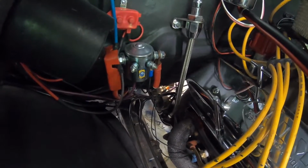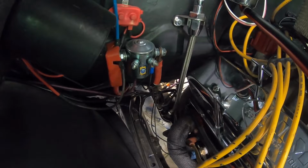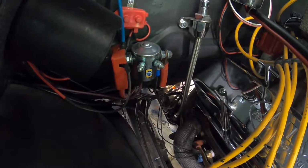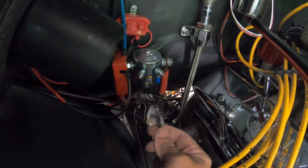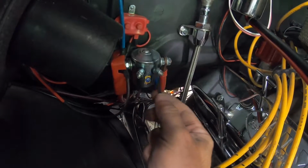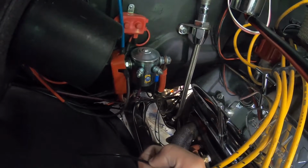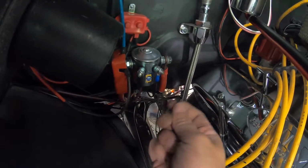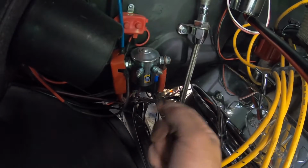So the first problem I had was, and this was when I was just testing the starter out, you remember, it would get hung up and I'd have to pull the battery post off to stop it, and that was because this solenoid was failing. Even though I took 12 volts off of my little contactor here, off my solenoid, the main contactors were fusing or sticking closed. They weren't actually spring open, which is the way it's supposed to happen. Send 12 volts here, pulls into contact, closes, you remove 12 volts here, should be spring open on this disconnect and opens up these contacts.